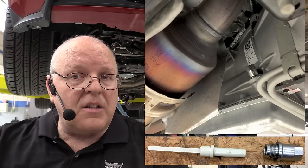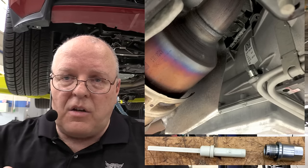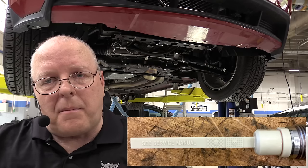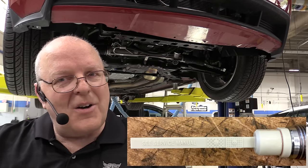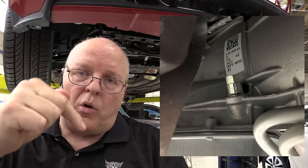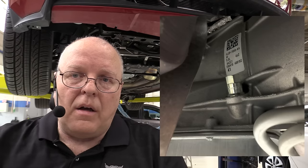The transmission that replaced this in later model Mustangs is the 6R80 transmission, and it also does not have the dipstick that most people are used to. It does have a dipstick, but it's a short little tiny thing that you still have to lift the vehicle up and get to from underneath. So they've gone away from this standpipe method of checking the fluid to — not sure if it's a better or easier method — checking the fluid with this little tiny dipstick that comes in from on top of the oil pan casting area. As soon as I get access to one of those, I'll show you how to check the fluid level on those. This has been a demonstration of checking the fluid level on a Ford Mustang without a dipstick. Thank you for watching.